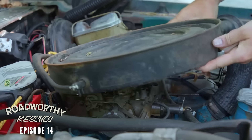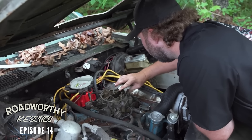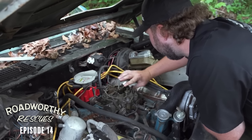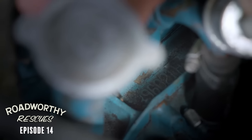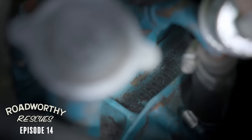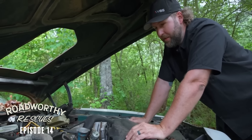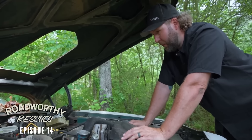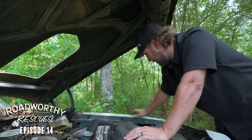We can throw a lightning cube in here and just test all the electrical system — make sure the ignition works, the starter's actually hooked up and doing starter things. It looks like everything's pretty well plumbed in. The casting number down here on the block is 396021F. The interwebs tells us that's a 455 engine from '68 to '72. They range in a lot of horsepowers, but that's actually pretty unique and cool because this thing should have a lot of torque. Why it got swapped in here I have no idea, but that's great news.